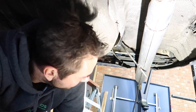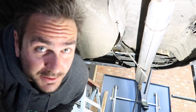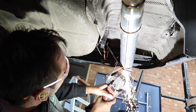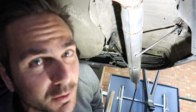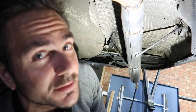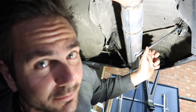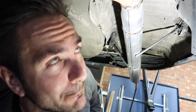Now that's welded on, I can just get the grinder and zing that excess rod off. Got the other one all bent up as well and it's sitting nice and pretty. Now I'm going to weld that rod to the exhaust pipe.